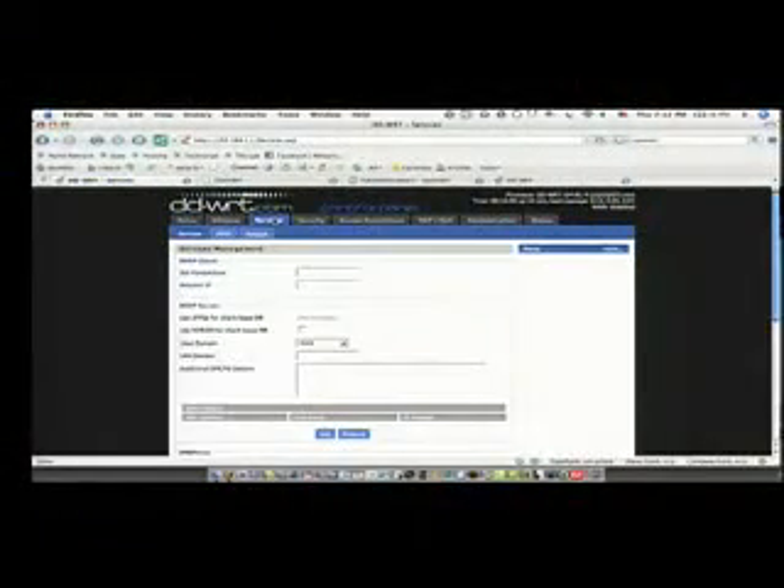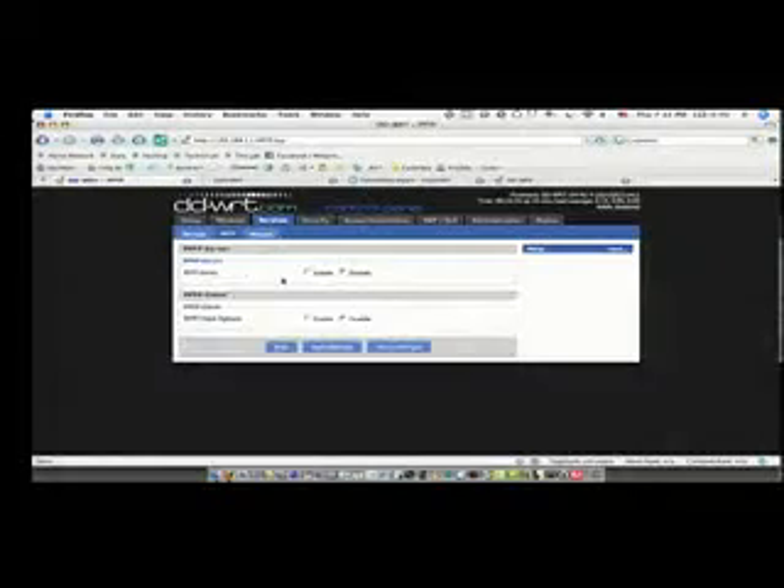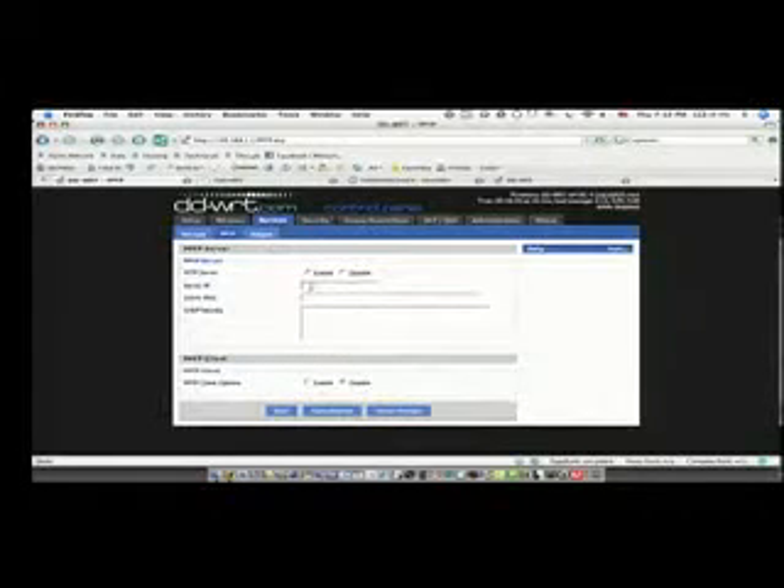Is this just with the basic DDWRT? Yes, this is right out of the box — no added components. It also has a VPN built into it — a built-in VPN server. So if you're on the road, you can connect back. How hard was it to set up? Actually real easy. People pay money to have a VPN server. You just go in, enable the PPTP server, assign an IP address for it as a server, assign a bunch of client IP addresses and a shared secret key — that's the password between the router and the client. And that's it. You'll be surfing through it safely.